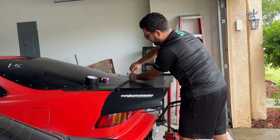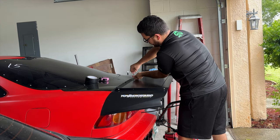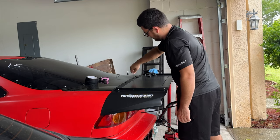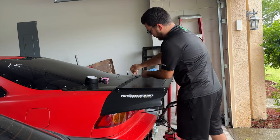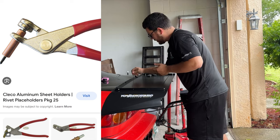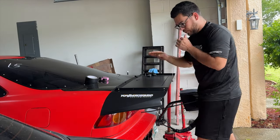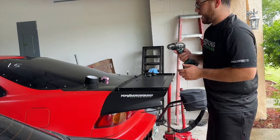This bolt I'm putting in is just a hair bigger than the pilot hole I just drilled so it's going to have some tension. It's almost creating a thread but it's into carbon, so it's not going to keep a thread — I just want it to locate and kind of hold the wing down. There are these little tools that people who rivet a lot of things, especially in race car panels, use — I forget the name but I'll insert it here. They're really good because they keep tension on what the unit is going to be held down with, so I'm trying to mimic that.